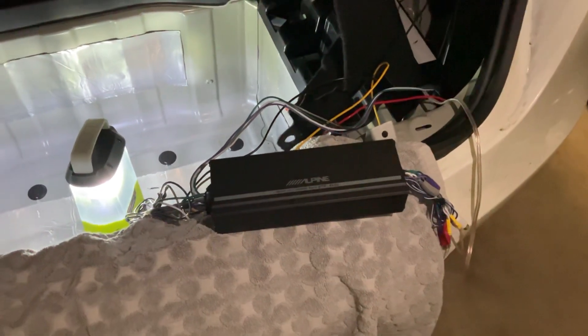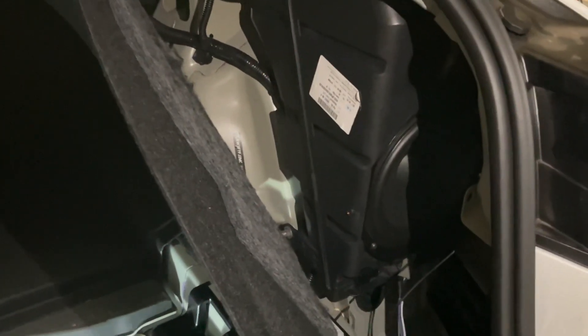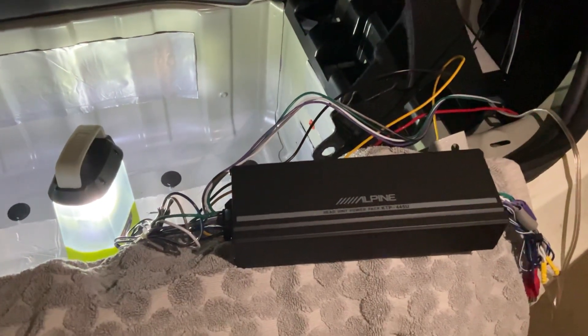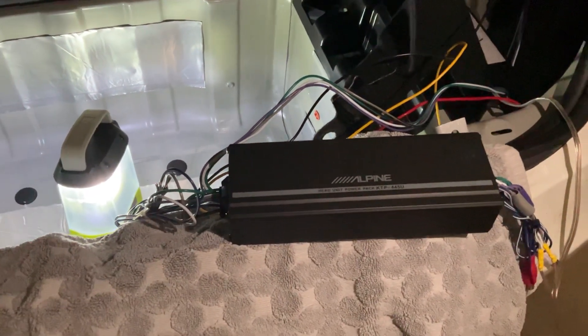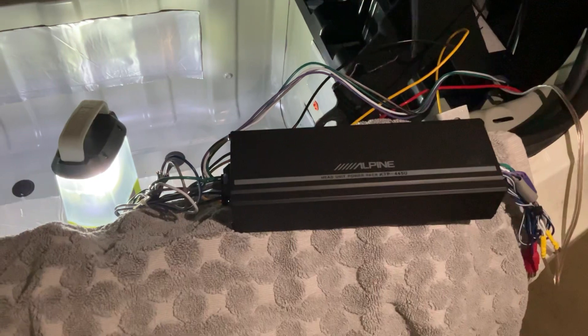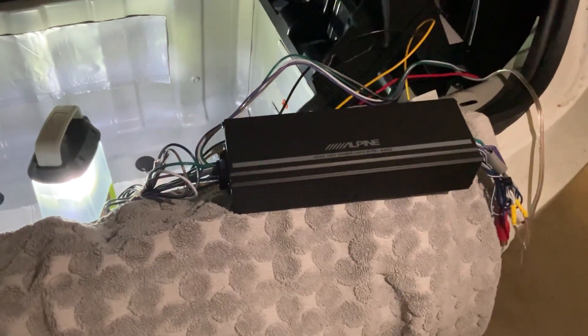There are a few good reasons why this was a good choice. The subwoofer has two voice coils — each one accepts 80 watts, so a total of 160 watts for the subwoofer. Bridging this amp to two channels gives 90 watts per channel, so it's quite a good match for power. Also, the amp has speaker-level turn-on, so there's no need to run a remote wire anywhere. And I've read that some bigger mono amps can cause issues with the Tesla 12-volt system — this amp is known to work fine, so that's why I went with it.